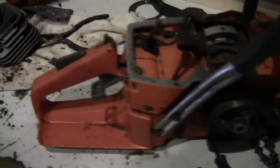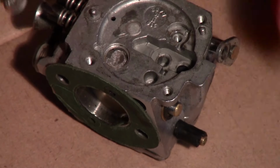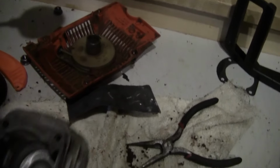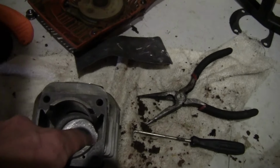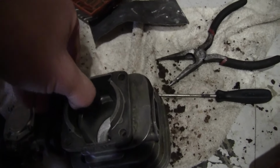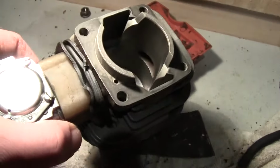They don't make, like, this saw's right from the 80s, maybe. Maybe 1990, but maybe a little older. And they don't make those anymore. Now, if you look here, I just finished rebuilding that carb. And you know what? Bearings are nice and tight. The connecting rod, nice and tight. No jiggling around there. Everything else on the saw is pretty good yet, except that piston. And I'm amazed the piston started cracking apart, and we had metal pieces from the piston flying around in the top, and that's what seized her up. But I'll tell you something, inside of this cylinder wall, you'd think that it would be scarred up, but it's as smooth as a baby's butt. Let's get some light on there. She's as smooth as a baby's butt in there.